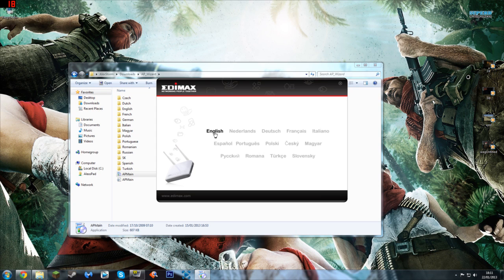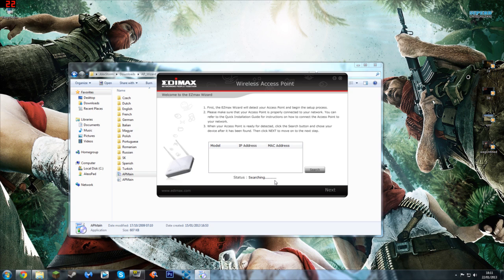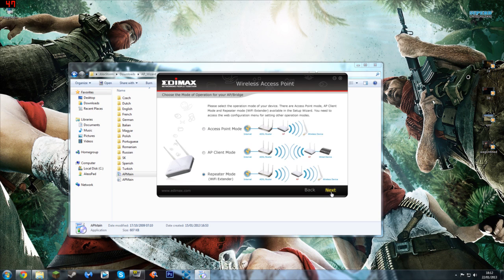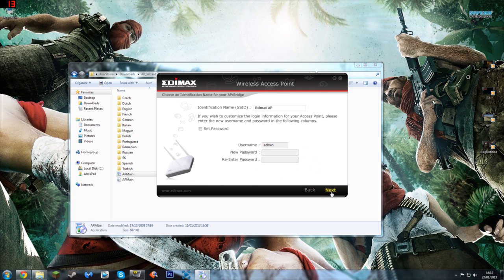Connect an Ethernet cable to the Ethernet port on the back of the Edimax AP, then connect it to your computer. Once done, click your language and it will search for the Edimax AP on the network. Press Next, then enter the credentials: the default username is 'admin' and the default password is '1234'. Press Next. When you first start, it should be on 'manually assign IP address' — I'd leave this as it is and press Next. Then select 'Repeater Mode / Wi-Fi Extender'. Make sure your AR drone is powered on at this point. This is where you choose the SSID your phone will connect to — mine is 'Edimax AP'.